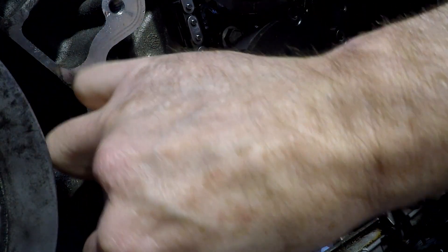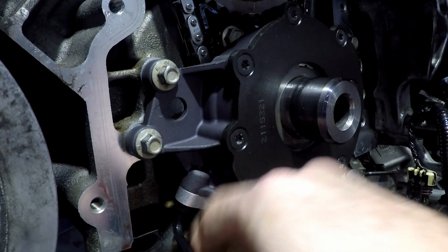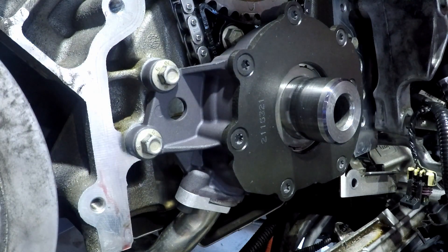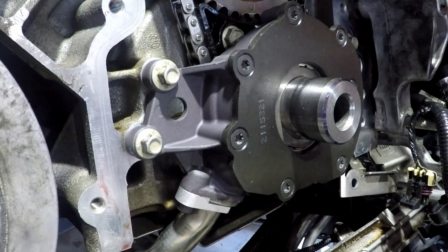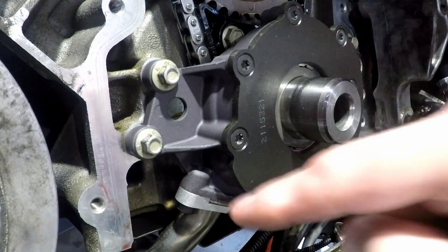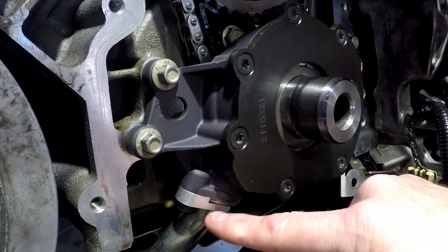You can see it's going to be flat against there and it just holds the bottom. I'm not going to be able to fit a torque wrench in here unfortunately — it only has to be 9 foot-pounds, 106 inch-pounds, so it doesn't have to be cranked on. That feels good. Now we're going to go ahead and tighten the allen for the girdle. I like having this, especially if I'm not using Loctite. That's at least 9 foot-pounds but not so much that the screw is going to break. Now we can go underneath and torque the nut to 18 foot-pounds.